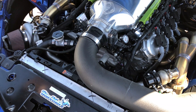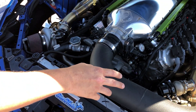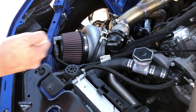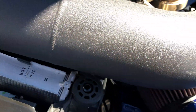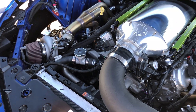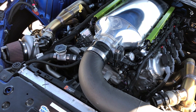Just make sure you take it out when you get there. But definitely super important — make sure that you are covering your turbos. This is enough because the air is not going to get forced past the filter to make the turbo blades spin. But even just 10 or 20 miles of spinning with no oil pressure is enough to ruin a turbo. And I can imagine that a lot of them get ruined that way, especially if they're sticking through the bumper and you don't think about it.